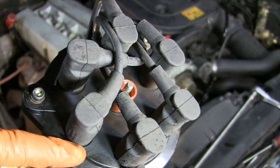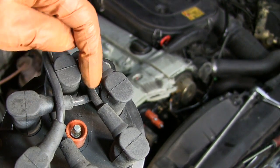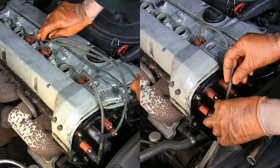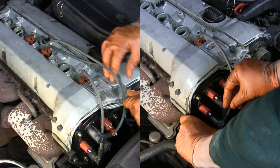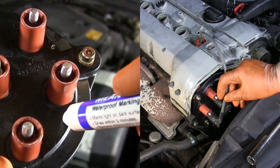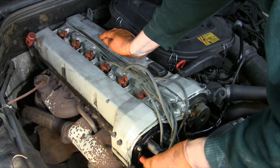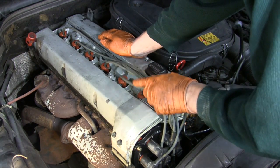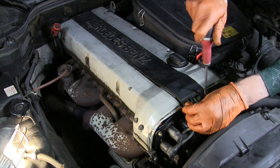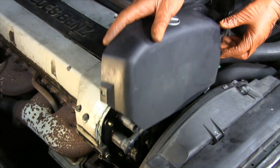Let's look at the old cap and wires. Notice how the wires are interlaced over and under each other — we are going to try to duplicate that as we plug the new set. Consult the old cap as a guide to plug each wire to its post and plug, and how to lace it as it goes on the cap. You'll notice the cap has cylinder numbers stamped by each post, and the wire length really dictates which cylinder it can reach for reference. With the whole wire set now plugged on both ends, straighten and dress the wires down the center of the head using the black spreader clip to neaten them up. Carefully tuck everything under the center cover without forcing or pinching any wires. Five Phillips head screws later and a snap-on plastic end cover, and you are all set.